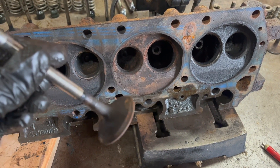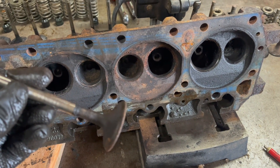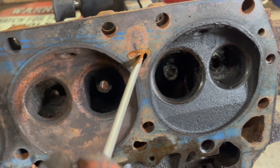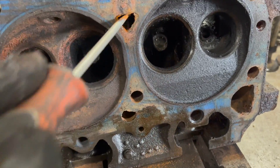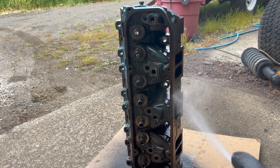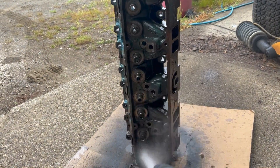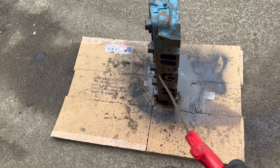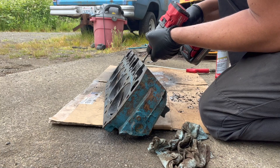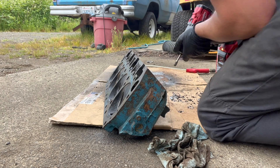It's entirely possible that these little bits of grime would have magically cleaned themselves as soon as the engine ran, but we're trying to make a few horsepower here so we really don't want to rely on magic. Also, great opportunity to clean out the cooling ports on your heads. Fresh out of the solvent tank — we'll use liberal amounts of brake clean and compressed air to get the solvent off and the head as clean as possible. It's like a hot tank, but much, much worse.